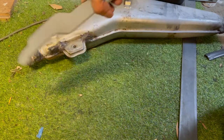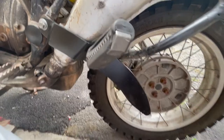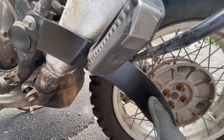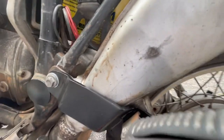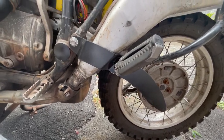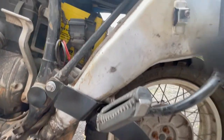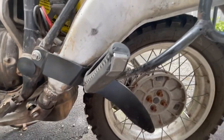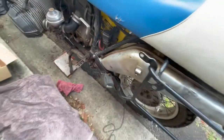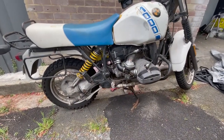We'll get some 10mm holes drilled and painted black. Beautiful. Got this thing in - this still flops down, that's good. This is coming down too far. We're going to find the right position here and lop that off and tidy that up, but that is really strong and it's not going anywhere. And that fits over that beautifully. Just got to work out how to get the guard that goes over here back on, because that's an essential thing for the structural engineer who has to give a compliance certificate - to the sidecar, not the bike. The bike gets registered and then away we go.